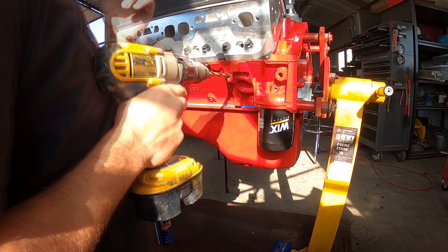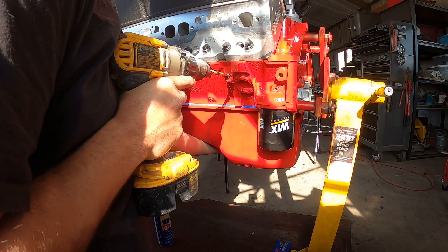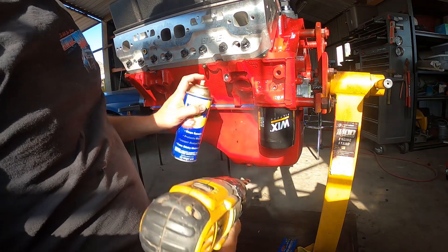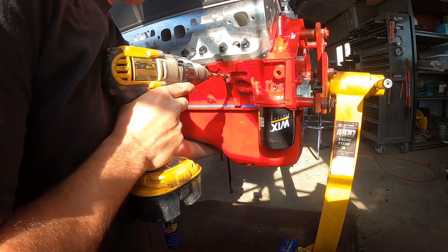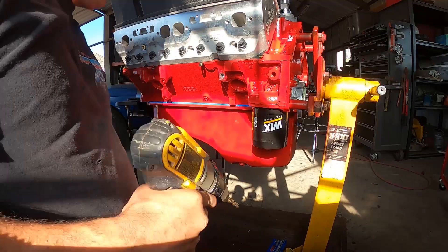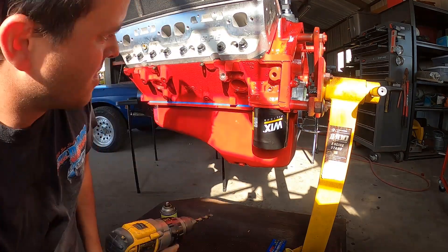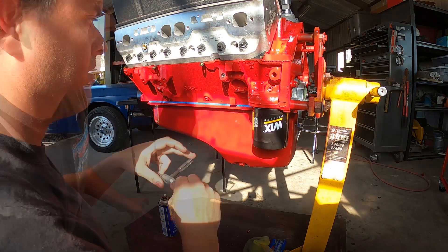Run with the drill safety on in case it snags — that way I don't have to worry about breaking a bit or screwing up the hole. You can also wrap this with electrical tape, but since I've got a pilot hole I'm just gonna be careful. That right there was running out of pilot hole — now we're ready to tap it.